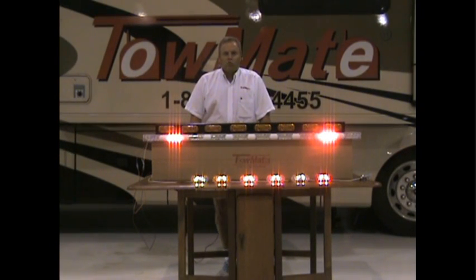All that is accomplished through two wires — a power wire and a ground wire. So anywhere that you connect to the common power and ground on a vehicle, you've got full control of these lighting packages. For example, if you were pulling a 40-foot trailer, put an aero stick on the back of that trailer, connect to the taillight lead and ground, and then plug the controller into the cigarette socket in the cab of the truck, and you'll have full control of that light bar on the back of the truck. You didn't have to run any extra wires, and it's a fabulous piece of new equipment.